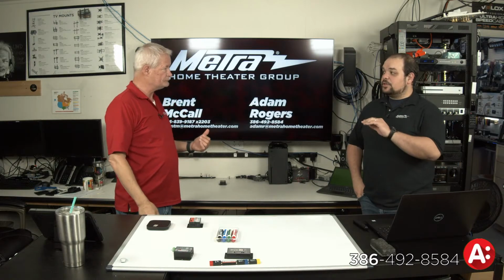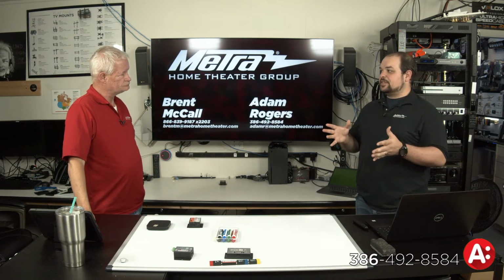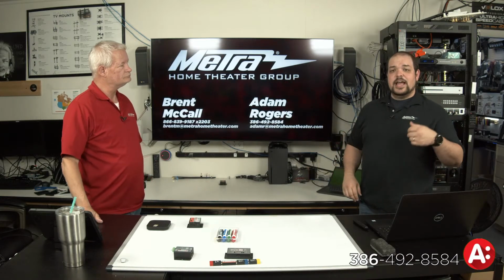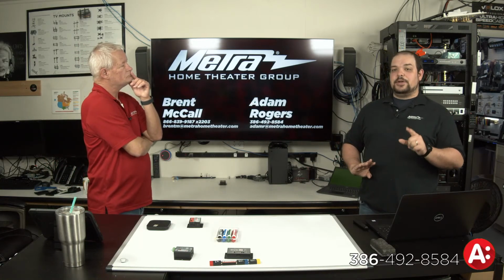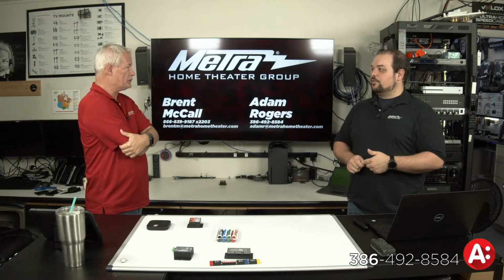Yep. And what we mean by that, of course, is that when it first boots up, EDID is the first thing that happens, because it needs to find out what type of display you are, what type of AVR is in line, and so on. And then at that point HDCP comes in and starts doing its part, gets the HDCP handshake, and what will happen a lot of times with HDCP is that it continues to check periodically. Typically every 3 to 5 seconds.